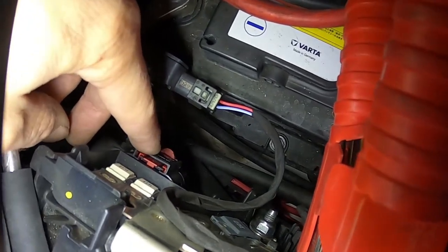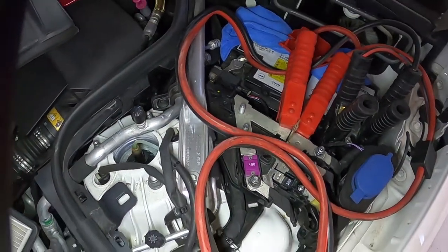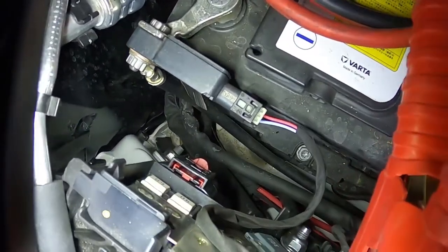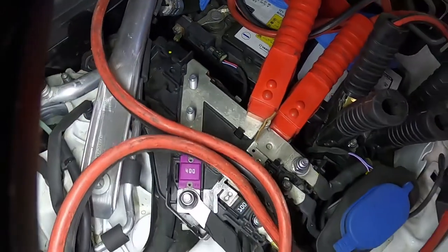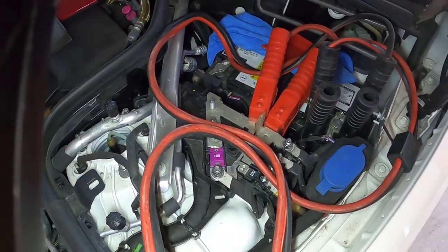Now my computer with the Mercedes software on it was complaining that there was no power to the hydraulics and to check that connector, and that twigged me to have a look, and there was nothing plugged in. So I found the cable dangling down the bottom, plugged it in, and great news guys, the parking brake now comes off.